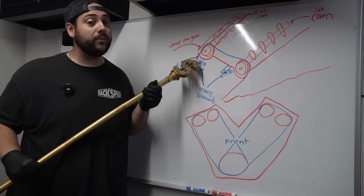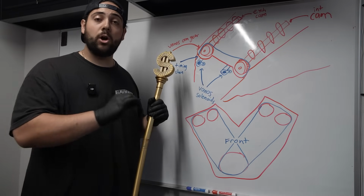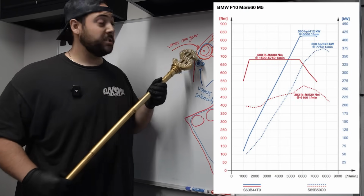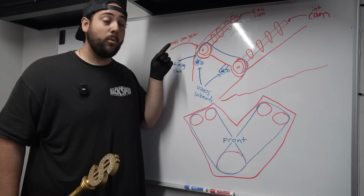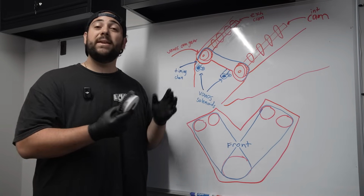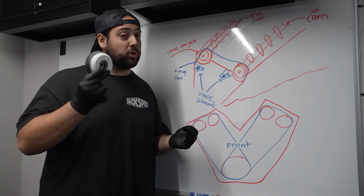While this is fairly complicated, it gives you the added benefit of having a very stable lower RPM range with good fuel economy and high performance up in the higher RPMs. It's pretty cool actually, not when it fails though. And what we have to do today is tear apart the engine and replace one of those cam gears. Because the engine at cold start is reading too far retarded, this thing is probably toast.